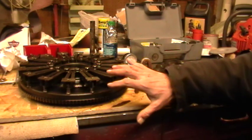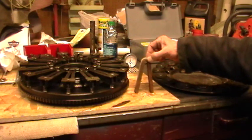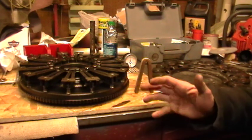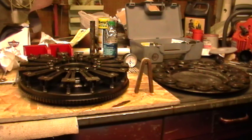After 90 years, some of the magnetism goes out of the magnets. There are 16 V-shaped magnets on the flywheel and since the flywheel is in pretty good shape — they're not loose and they're relatively flat — we're just going to leave them on there and try to charge them up.